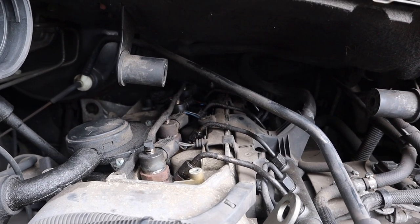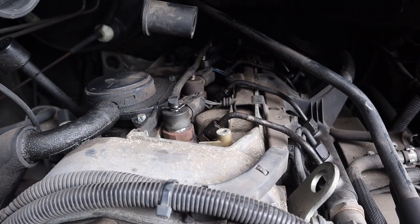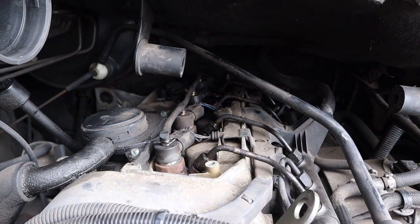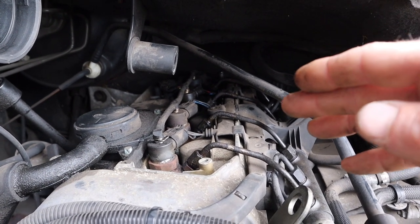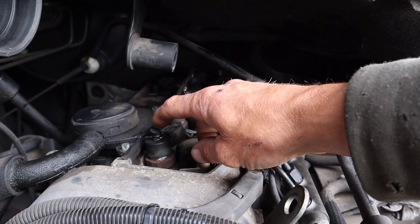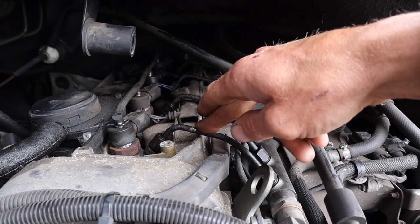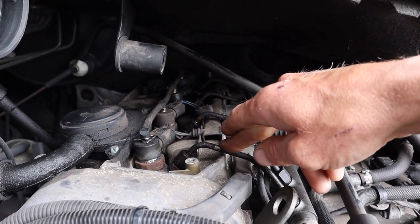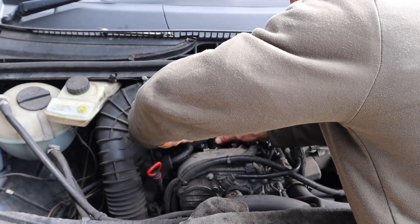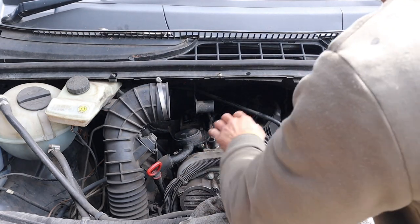I've already pulled these clips out. Be extra careful when you pull these out — these little clips go in there, four little clips. Pull them out carefully because they do just ping, and if you lose one it's a right pain. Get this clip out. Get these return lines off and get the main fuel lines off, which are 14 mil. Be careful when you get these little clips out because when they ping they go quite far.